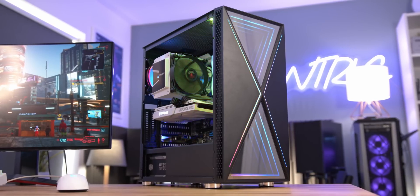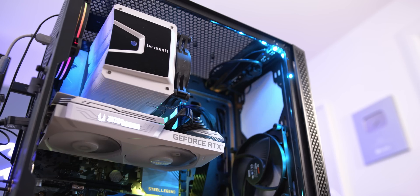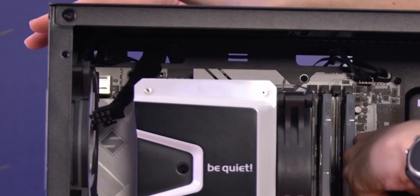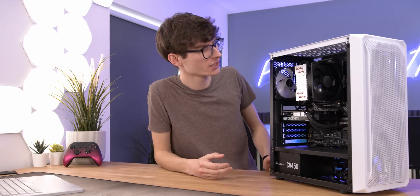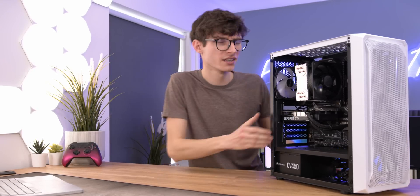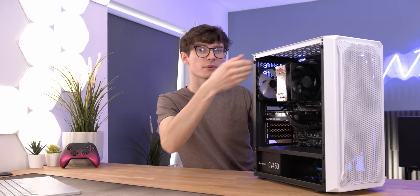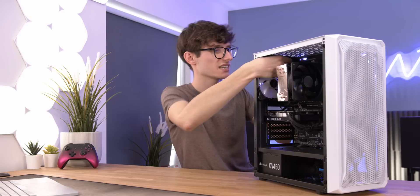In the more compact, usually cheaper cases, the cutout for the CPU cable will be really small with very little room to actually fit your fingers in. So before you start your build, analyse what's going on, and if you have a modular power supply, just get the power cable itself, feed it through at the top, plug it into your motherboard, and then screw your motherboard in. That way you've not got to put your hand in there and try to fit it in after the fact — which can be pretty much impossible with larger hands.